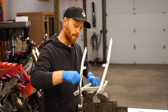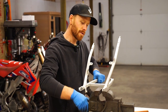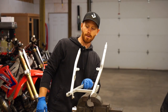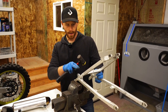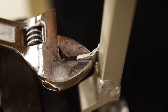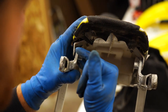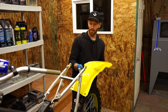You guys would be surprised how easy these subframes bend. One time on my 125 the thing was just completely mangled, and I just threw it in the vise and it bent back perfectly — you'd never know. So if you have a bent subframe, don't be afraid to try to straighten it out. While I'm at it, I'm going to tweak back all these little brackets that got bent up too. I'll throw a seat on here and test that as well. I am going to call that good — nothing better than a perfect fitting subframe.